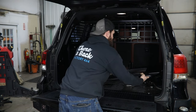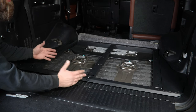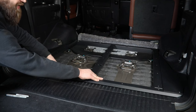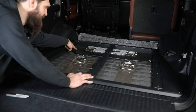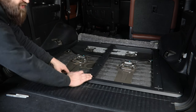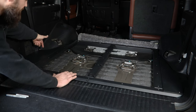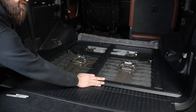Once you get it set down on one side, you can let the whole thing rest down in here. With the floor frame down, you now need to locate it properly before marking and drilling those holes. It kind of floats around a little bit — the first thing you want to do is slide it all the way back until the back of rail number four is tight to the front edge of this passenger compartment air duct on the floor. That'll help square it up as well as locate it so the holes you're drilling land on the proper raised rib in the floor. From there, make sure everything is located properly from side to side, checking all of the gaps along the outside panels and making sure they're as even as possible.